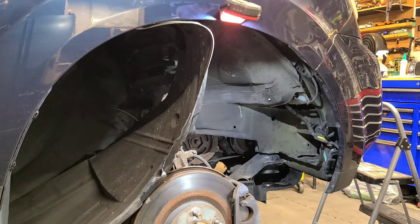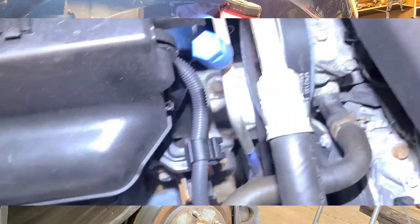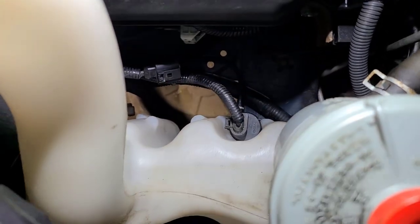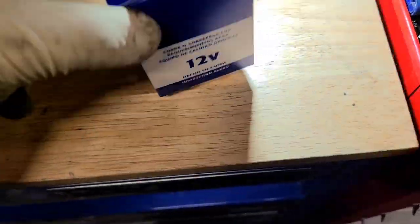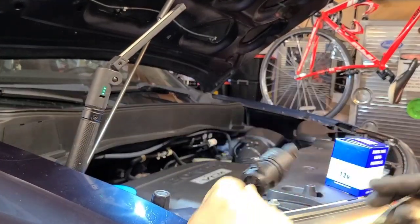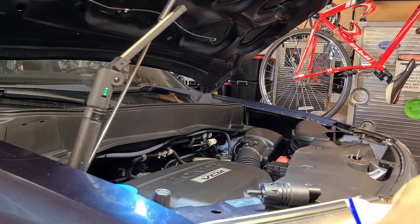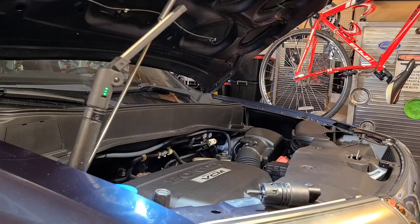Let me get a pan for this and I'm gonna pop this motor out and see what's going on. In the back you may or may not have to remove your inner wheel well shield unless your pump is stuck — and mine was stuck. You got two pumps: one on this side and one on that side. This is the part I decided to go with — the part number here from AutoZone. It was $27.99. This is the original OE pump and this is the new pump — it comes with a rubber grommet as well.